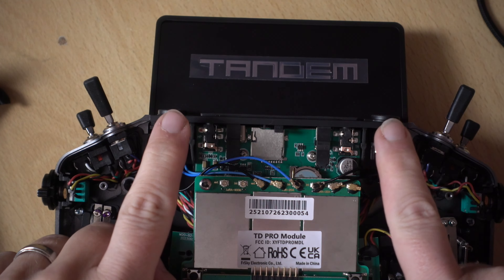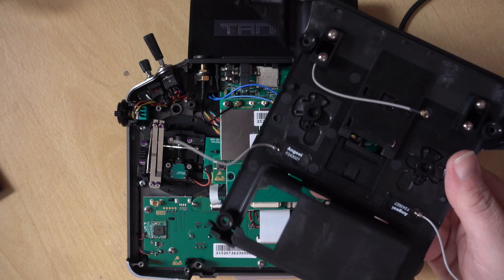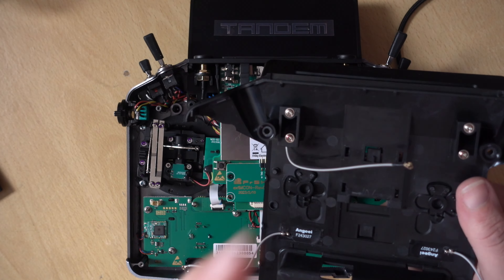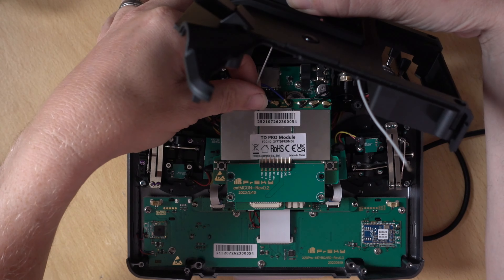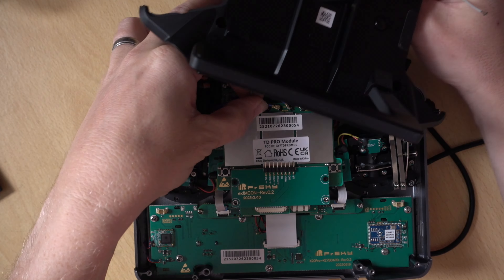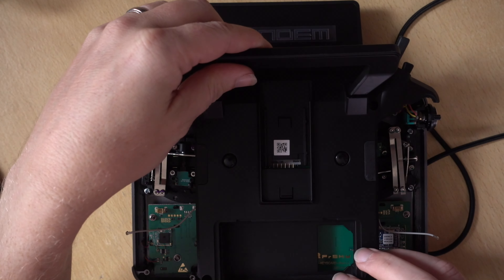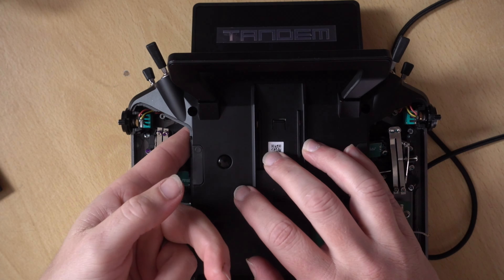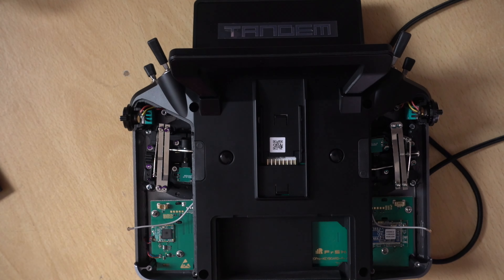But there are only two antennas. Now I'm going to put the middle part of the case back on — so this is like a reverse disassembly guide. You can see here the antenna for the 900MHz internal and also the antennas for the Bluetooth modules. The first thing we need to do is plug this antenna back in. That clips in, so we bring that around to this side and circle that around — that should just slide straight on. We just want to make sure that lead is not snagging in the grip, which seems fine. So yeah, make sure you plug that back in. Now we have our back in place we can put the screws in.